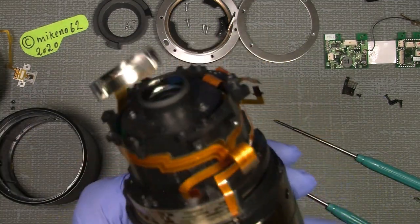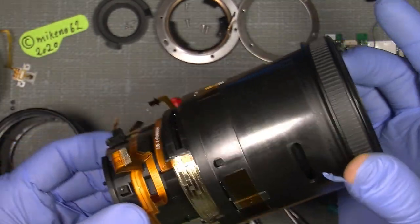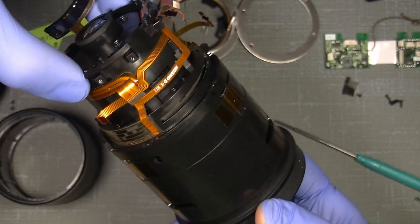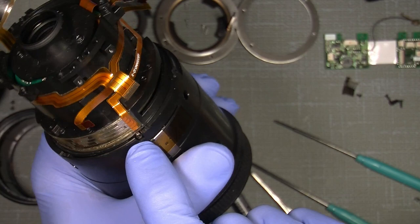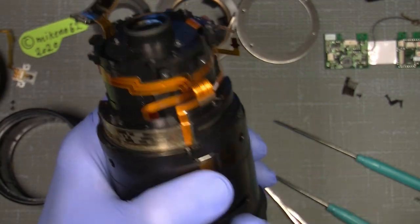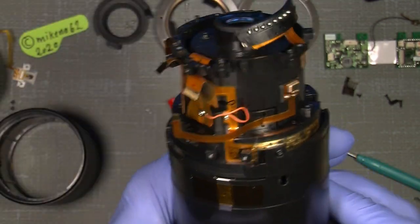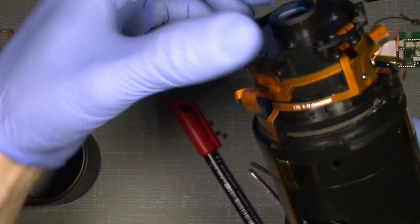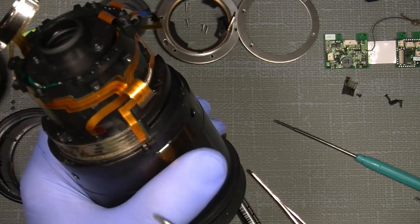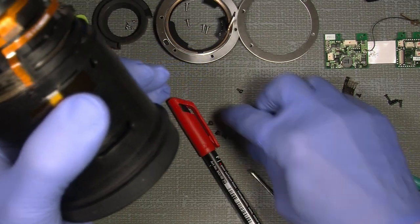And then the next thing is, you see the focusing ring here also has one end and the other end, and in the other end there is a tiny stop screw, which sits here, and we need to unscrew that. My reference mark here is also very important, so I set it to my reference mark here, and the screw is visible. If not, it's the wrong place. So there has to be one. Then unscrew this one. There is a special screw. Those are two.